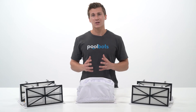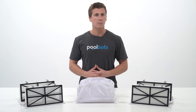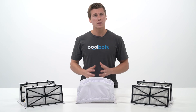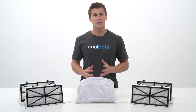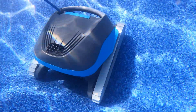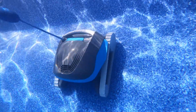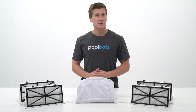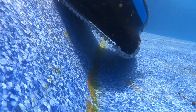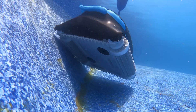When it comes to filter media, there are three main types available: fine, ultra fine, and the oversized leaf bag. First, there's the cartridge that comes standard with practically every robotic pool cleaner — the fine filter. Most robotic pool cleaners that come with only one filter media type will come with this type, because it does a little bit of everything. It can pick up smaller debris suspended in your water as well as collect some larger debris such as small leaves and twigs, but it is also a master of none of these.